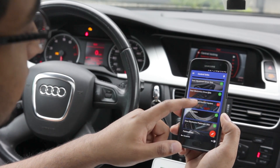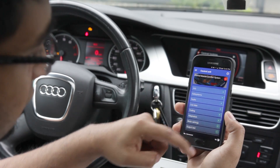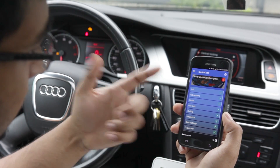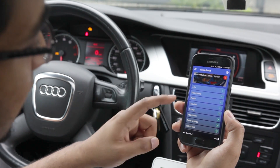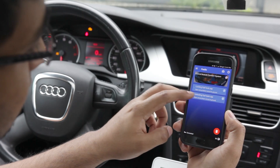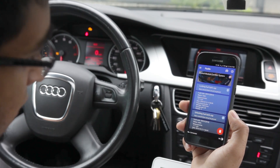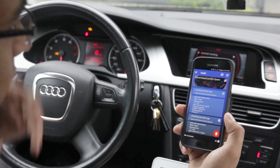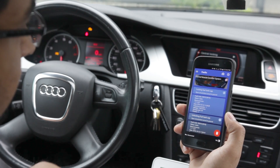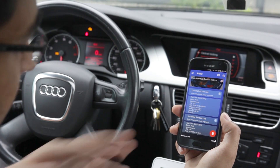One of the things that came up as a fault in my car is module number 46. When you go into it you have different options — 'Info' tells you more about the module and software. The most important thing for us right now is going to the faults menu, and there it is: two fault codes. Essentially this is referring to my locking mechanism being out of sync with my central electronics, so every time I lock and unlock the car my fuel cap should lock and unlock, but the unit inside the mechanism is not working.